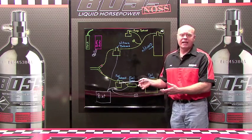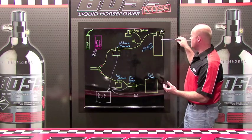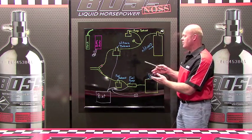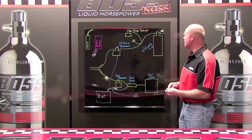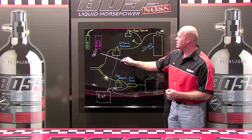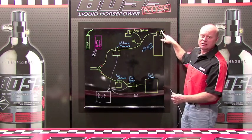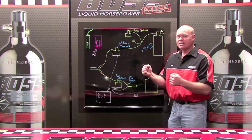What are some of the ways they've come up with to solve this problem? If you hit your nitrous button and the pressure drops, then you let off and try to hit the button again, the pressure is already down in the bottle so your nitrous and fuel ratio will be off. They've got to get the pressure back up, and the way they do that is by temperature — the outside temperature of the bottle dictates the pressure inside. One of the oldest solutions is to take a torch, light it, heat the bottle up, watch the pressure gauge, and as the pressure rises, set the torch down, hop on the vehicle, and activate the nitrous switch.